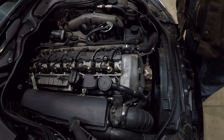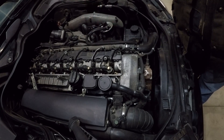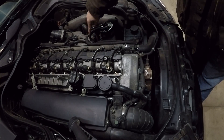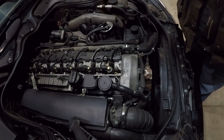We'll go all the way from the inlet tube, which is actually down here. Both inlet and return lines are right down here from the fuel tank back there. They come up under the chassis, up and over here, and then you have your inlet line right here. It goes into the fuel filter, and this is actually pressurized at 120 psi from the pump that's in the tank.